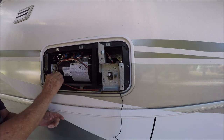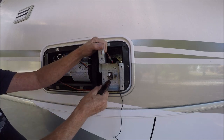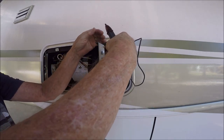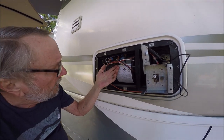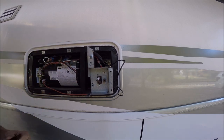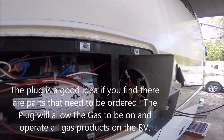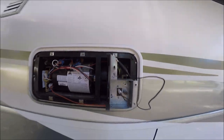This connection goes to your gas valve and this is your electrode. You can unplug those and pull it through the hole to take the whole assembly out. I've wedged it here so I can test it. I have a ground cord on here, a switch to turn it off and on. Gas is turned off and plugged with a three-eighths plug using yellow gas teflon tape — not the regular white tape.